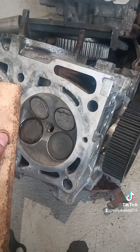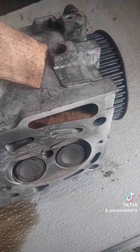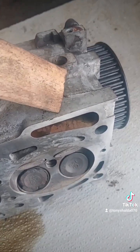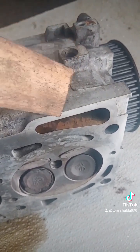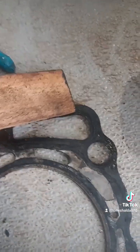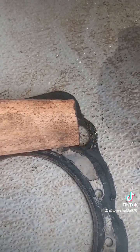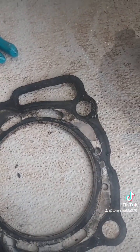But that can't be the problem — that's a very thick piece of metal. Even bolted down there and there, it still puts enough force right there to keep that gasket tight. Not really. Cast aluminum, like all metal, will expand with heat and contract when cooled, but it's very soft and flexible — you have to think of it like a sponge. I can expand and contract this area right here without affecting the area up here, so it really doesn't matter how much support I have above it. I can move this metal with enough heat, and all I need is a heat source — something like an exhaust port. Once this metal starts moving around, it wears at this gasket making it thinner. That damage will migrate up to this bolt right here. Once it gets to that bolt, the gasket material being thinner loosens the bolt, taking its pressure off the compression seal. That causes your head gasket to blow.